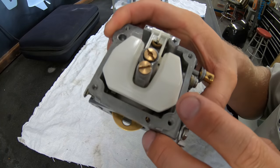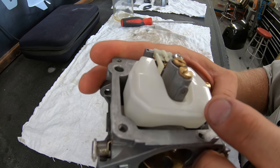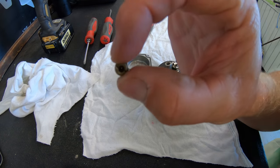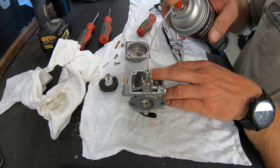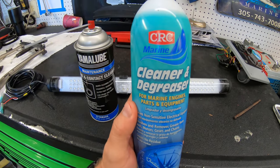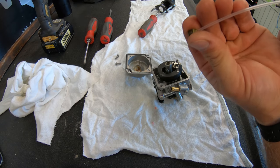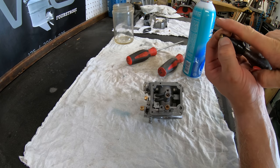As long as the needle tip looks good, set it off to the side and begin pulling the jets out. Depending on your carb there might be one or two jets — one is a mid-range and one is a high-speed jet. Sometimes they are plugged off or they have a small hole through them. We need to take some contact cleaner and make sure they are cleaned out. It's nice to use a contact cleaner like Yamaha brake cleaner or CRC cleaner so we can visibly see that there aren't any obstructions blocking the flow of fuel through them. Use some compressed air to blow out any debris you might find.